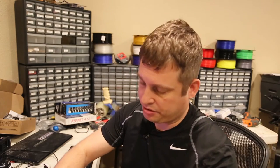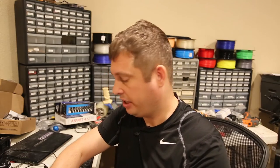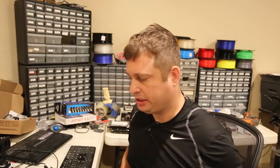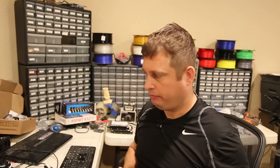So on a whim, I'm going to go ahead and try the other connectors. There it is. The pinout's not right. For whatever reason, the video signal is actually on the red connector. So it does work, it is verified — you will get a video signal if you use one of these cables. So this is a cheaper way to get video out of this thing.